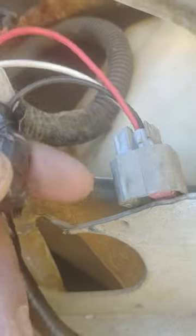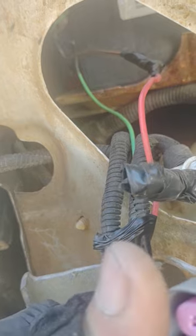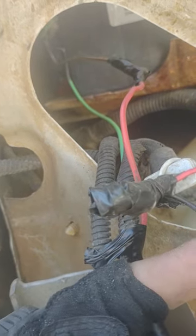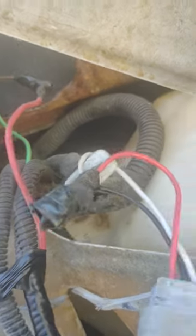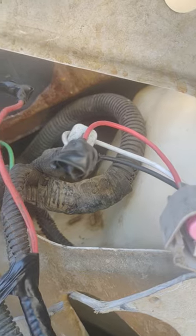The white wire with the blue tracer on the far end is for the turn signal, and that's what I have the red wire tied into. Here's some janky work I did earlier when I first got the truck. This is a 2002 and they come with the plug for a 9007 bulb, but I upgraded to the '05-and-up headlight housing, which uses the 9008 bulbs. So I just tied into the existing wires — you've got your ground, your high beam, and your low beam.